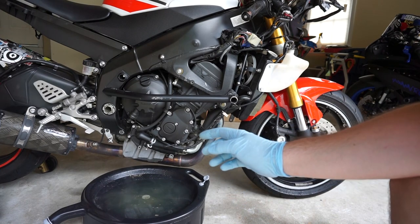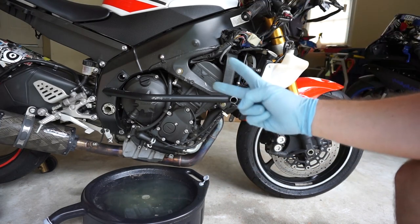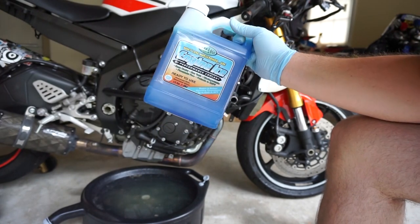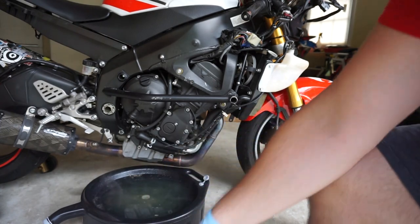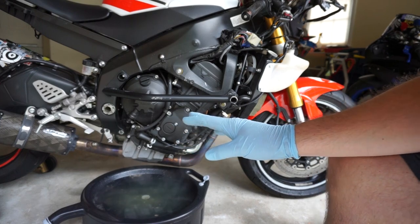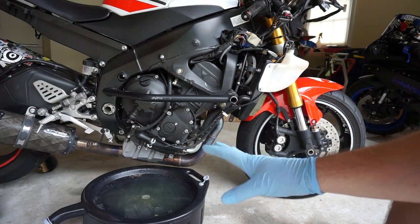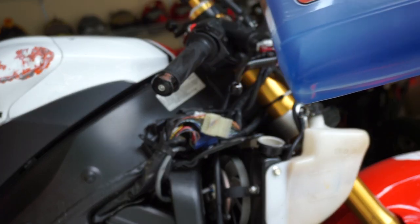There is very little to no more distilled water dripping out the bottom of the bike, and we've done two cycles of distilled water getting the bike up to temperature. Now it's time to put the nut back on the bottom and fill it up with engine ice — after that we're done. Screw the bottom nut on and then we're going to start pouring the engine ice into the radiator. Be careful letting the bike cool — do not get impatient and try to do this early. The liquid coming out of that bike is really hot and I don't want you to get burned.